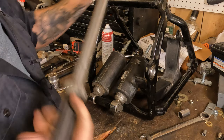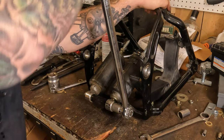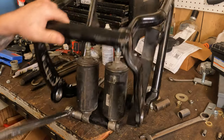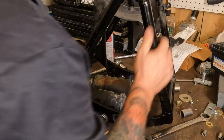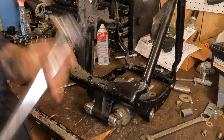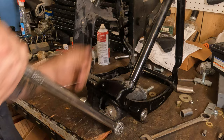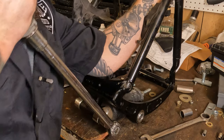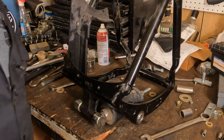All right, so I've got this set to 120 foot-pounds. There's that one. Then we're going the other way, so, oop, that's not going to work. Let's turn that thing around there. Again, whoop. 120 foot-pounds. Almost there. There we go. All right. Whew. Swing arm's ready for reinstallation. Let's move back to the motorcycle.